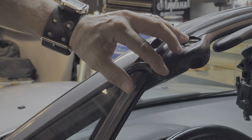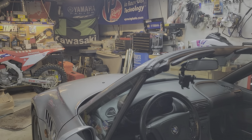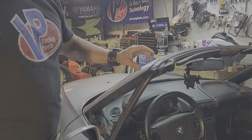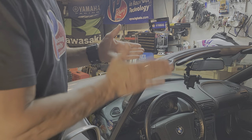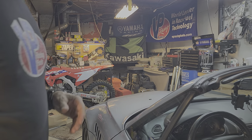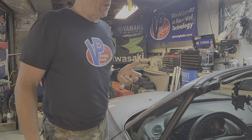Hold it in place here for a few moments, and just follow the instructions of your inner tube patch kit. You'll scuff it first, make sure it's clean all through there. Put a little bit of your adhesive on it, let it dry a little bit, put the patch on, let that dry, and you should be good to go. And it worked for me, and it's worked for plenty of other people, so give it a try.